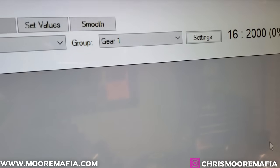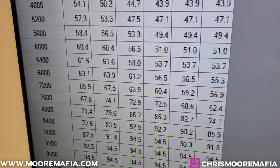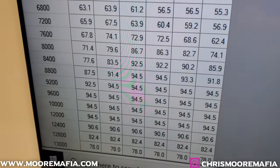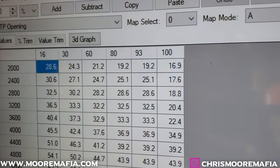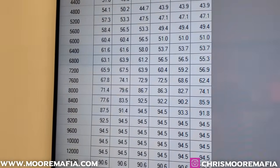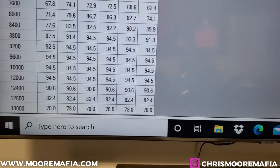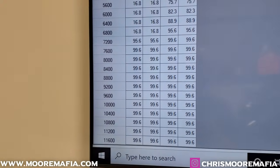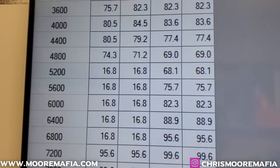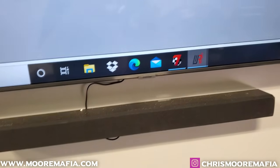We're going to change it to fifth gear. Same way — it never opens the secondary throttle plates all the way up. So what we do is open those up. We also open the exhaust valve on this thing a little sooner. If you have a slip-on exhaust, this stuff helps as well. You can see the exhaust valve basically stays open the whole time on this one — it does not close back off.